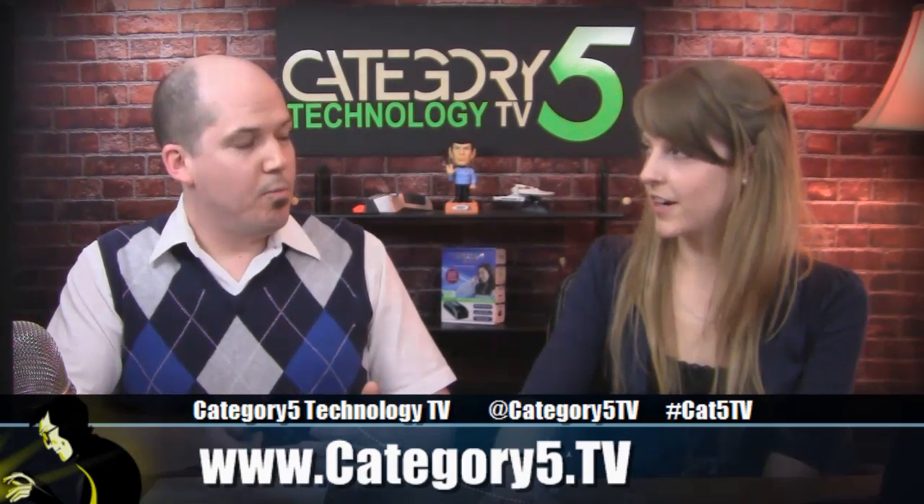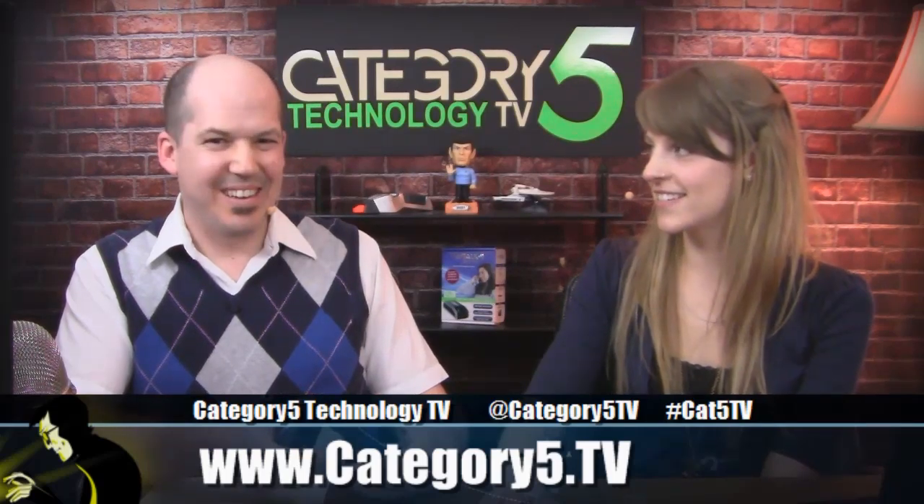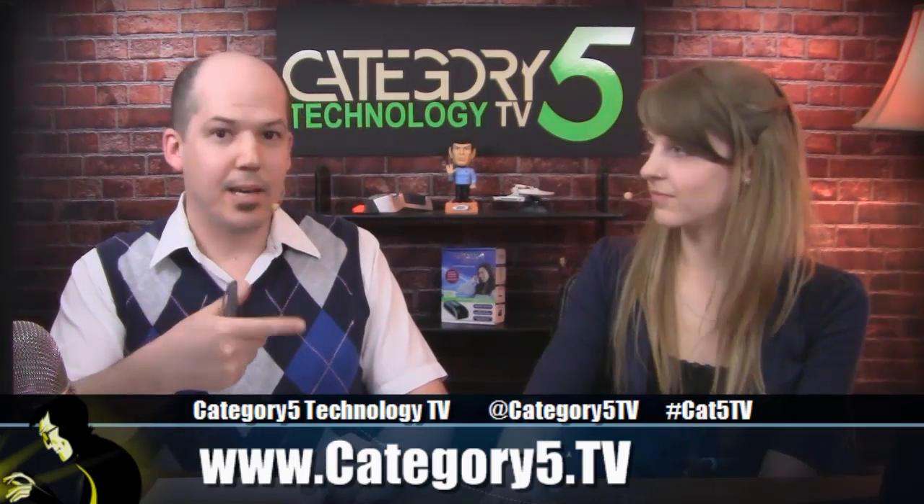You've got this hard drive, it's external, you copy all your personal data to it, you feel like you're safe because now it's encrypted. But yet you plug that into another computer and because it's going through the decryption chip that's built into the external chassis, there's no protection. It gives you a false sense of security, thinking that the stuff on my drive is encrypted — because the chip that encrypts it also decrypts it when you're using the USB, SATA, or eSATA connector.